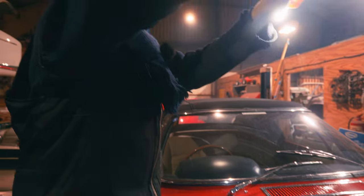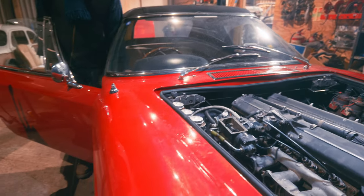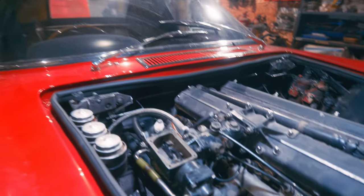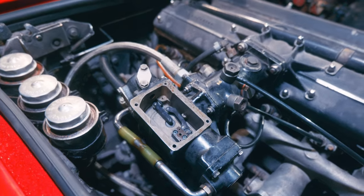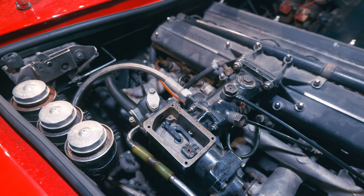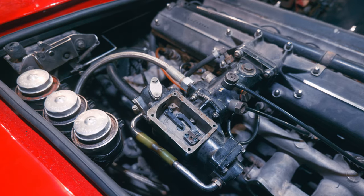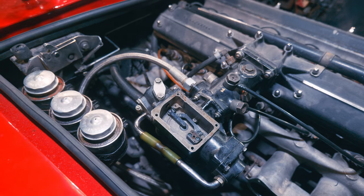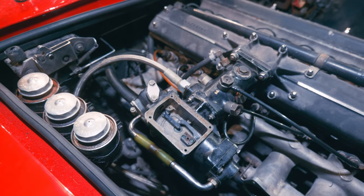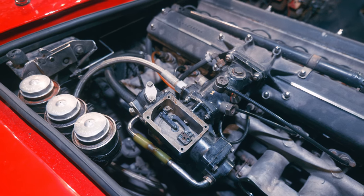If I turn it off, we'll see what happens, how it'll all sync back. See? So with no depression on it, it pops back, because it's got no depression there now, has it? If I start it up with the fuel pressure behind it, it'll move that in that direction, won't it? Because that little one will ram out with a roller on the end. See? When I start it up with the depression, it'll pull it that way, won't it? Because it's got no manifold depression at the minute. Until you start it up, then it will have, you see? So with lift depression pulls it that way. And when it shuts off, it'll pop back this way. And that's it, really. That's how it operates.